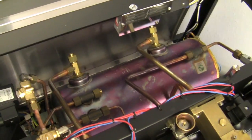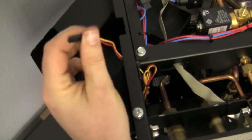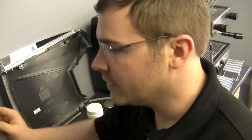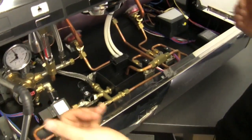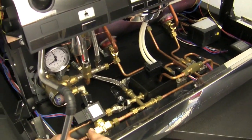It was pretty easy to open up the machine, right? Very simple. The Aurelia II — they've made it very simple to get into it. It takes about three minutes, truthfully. Two screws, take off the side panels, they come right out. The only thing you really got to pay attention to is these connectors here. These are what run those lights — the steam arm lights. They're connected to make that happen. Disconnect that, it pulls right out. Down here, two screws take that whole front face off, and there are two more screws to take that out. That's the whole process.